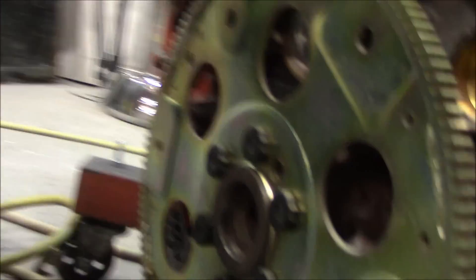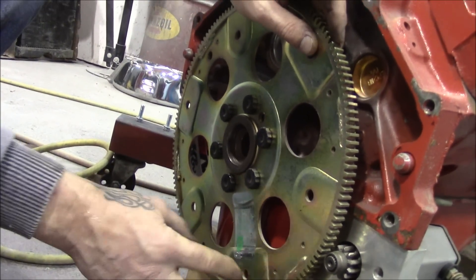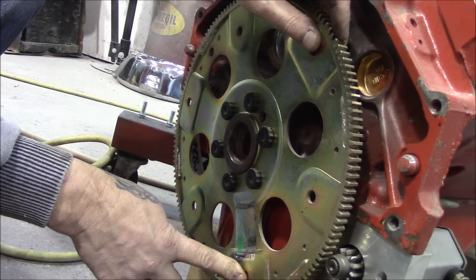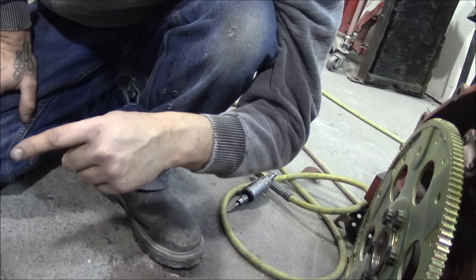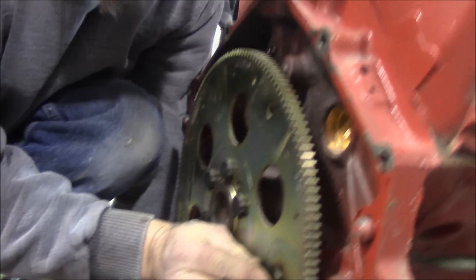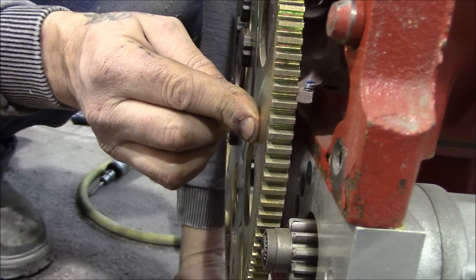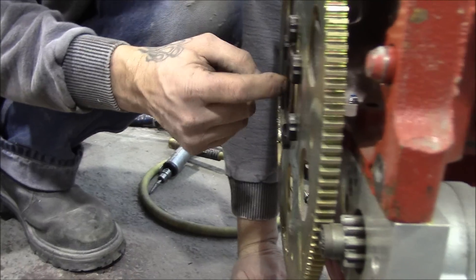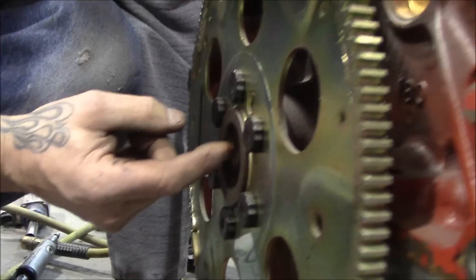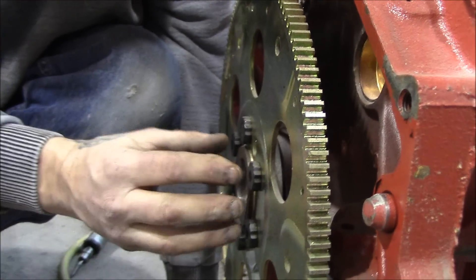You'll put your bolts in when you lift the motor up in the air. You can see the tranny stops here - it's open here and this is still gonna be spinning around freely inside. This is where you have your three points where bolts go on, and you must get the proper bolts to put the torque converter to the flex plate - you must have the proper bolts, you can't just use any old bolts. When I go to mount this tranny up on here, the torque converter will be sitting out about the distance of my finger.